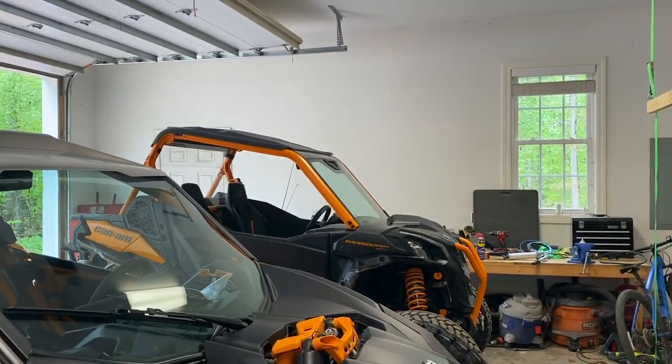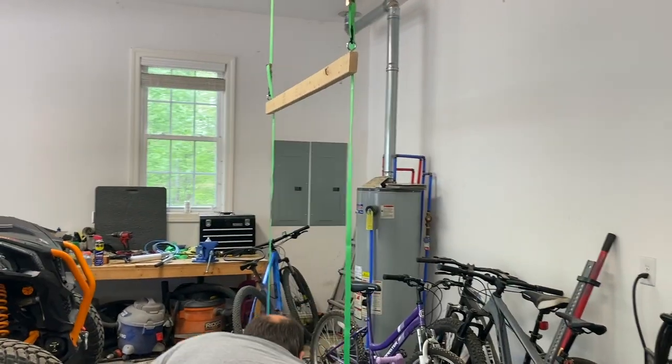The real reason I went to a 35-inch tire over the 32 is extra ground clearance. The X3 is a really long rig, especially compared to the Sport. The Sport is shorter in length, so the breakover angle over rocks is better. Nathan and I ran into this at Copperhead Cove — he was going over straight ledge rock faces without touching, and I was dragging my rear trailing arms. That's really the reason I went to a 35: I wanted that extra bit of clearance.